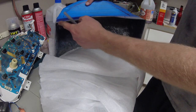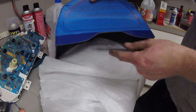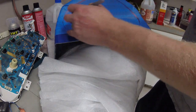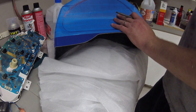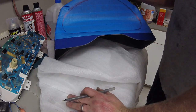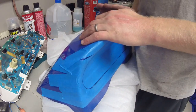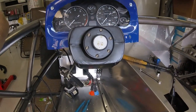This cut doesn't need to be perfect because there's edge banding you put around to cover the ugly edges - all the body panels get edge banding, because it'd look like crap without it. I'll cut inside, mount it, see how it looks, and trim a little farther each time until I get the perfect fitment. I'd rather cut two, three, four, even ten times than cut once and have it be too big. They already charge about eleven to twelve hundred dollars for the bodywork, so trying to avoid having to remake it.